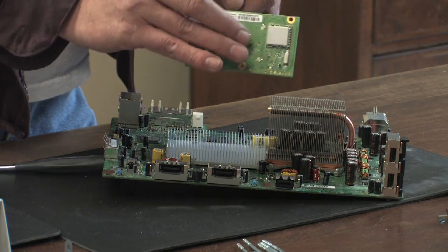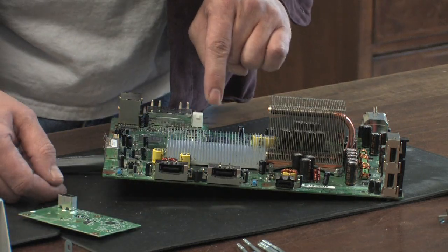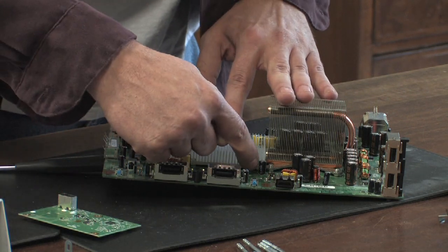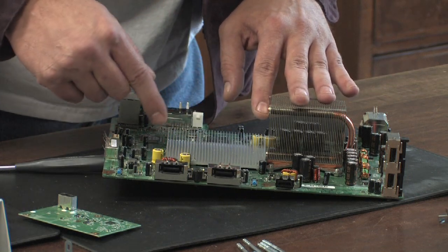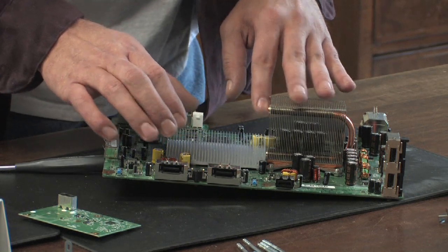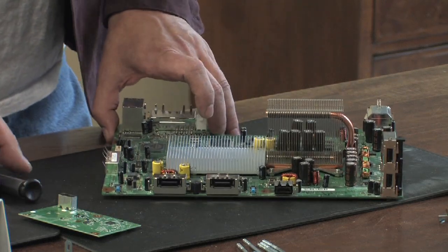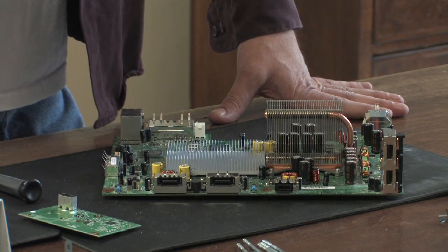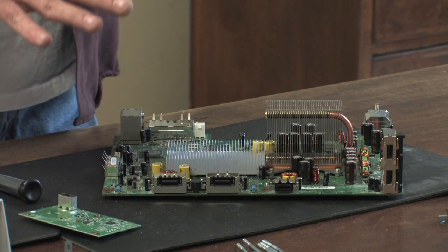After that, turn it off with the button, and then take a hot glue gun. Do not press down on top of the heat sink itself; run a bead of hot glue all the way around the bottom — the base of the heat sink — to hold it in place. But do not push down, because that will cause your E74 again. After that's done, reassemble the Xbox, but just remember that this Xbox now has to lay on its side.